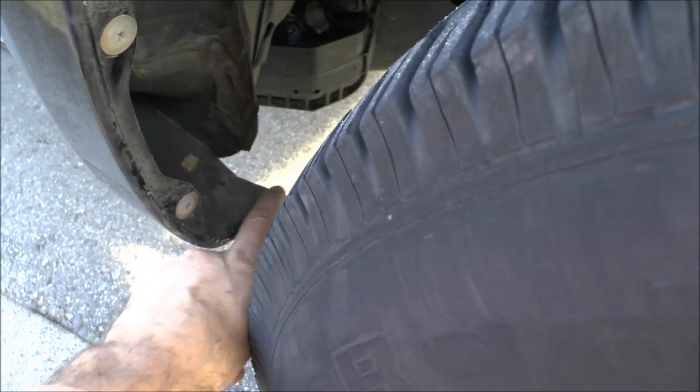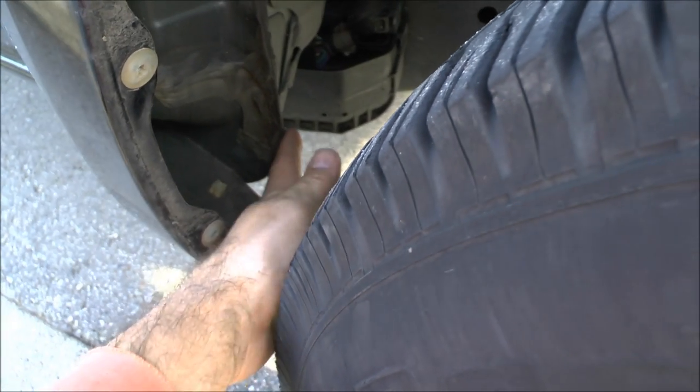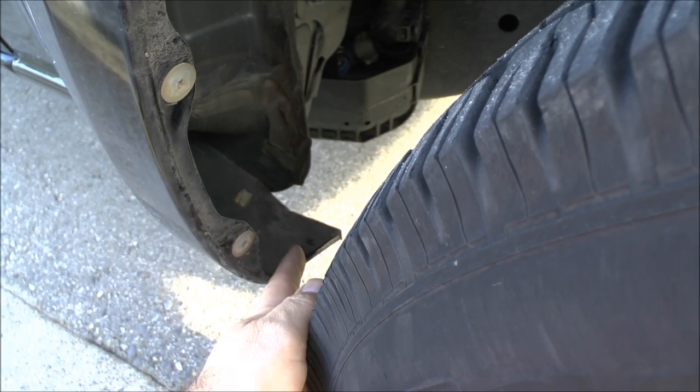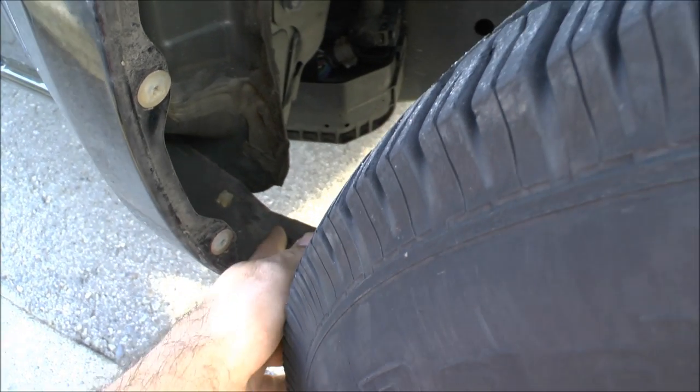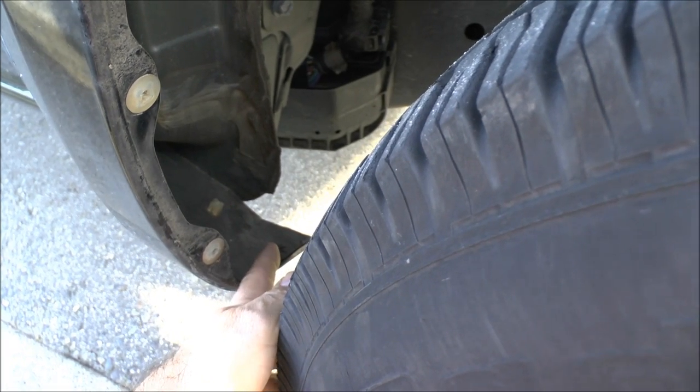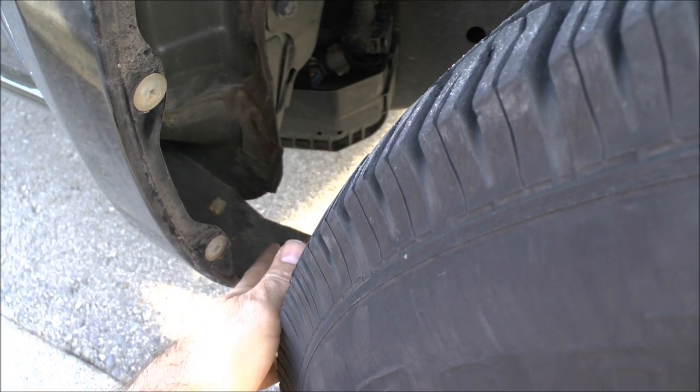On this side you're gonna have to cut here, so I'm gonna get a hacksaw and cut an angle here. Then any bare metal that's showing I'm gonna sand it and just paint it black again so I'm not going to get any rust.